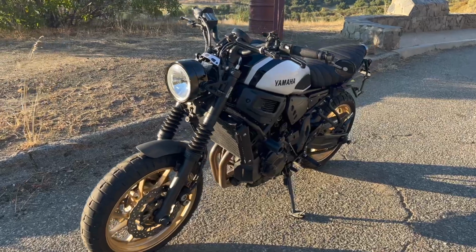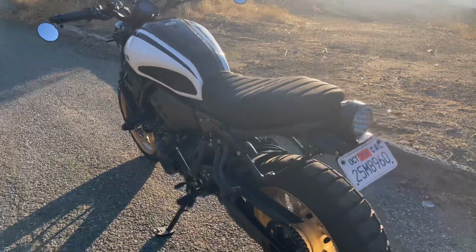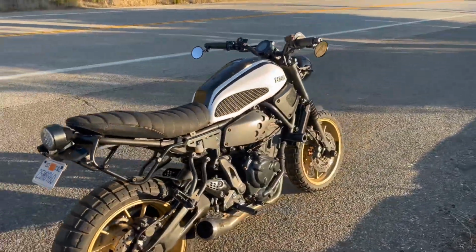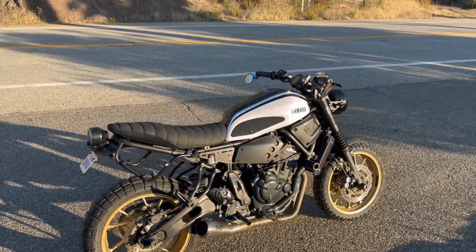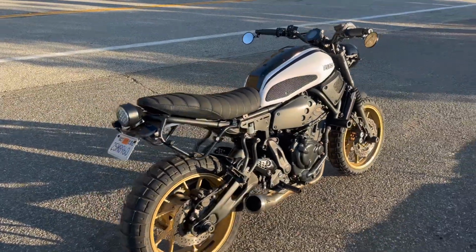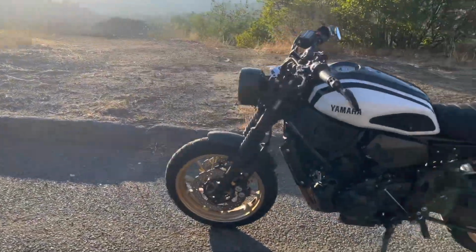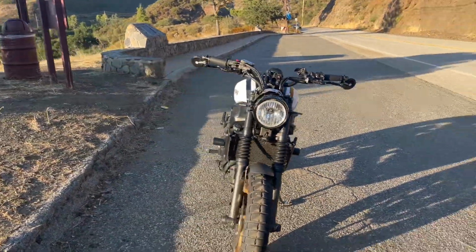So I got everything assembled. Everything's working great, feels great. And the reason why I lubricated the suspension link pivots, obviously since the manual said so at 12,000 miles, I was a bit overdue. I noticed every time I sat over the bike, there was this squeakiness about it. So I knew something was drying up and needed lubrication, so I thought, hell, why not? And it feels a lot smoother, I gotta say, even over the bumps and whatnot. Just feels more fluid, it just feels faster.